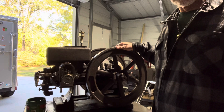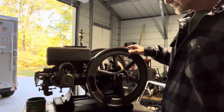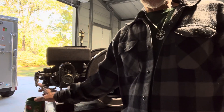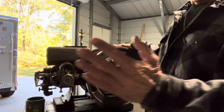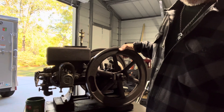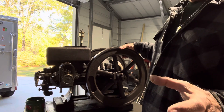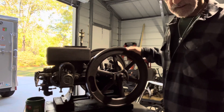We got 226 degrees on this engine, so I'd consider that fairly good — it's within the 225 to 230 range. It's a good way of seeing whether you've got the cam gear where you need it. If you can't get 225 to 230 through the adjustment at the end of the rod, then you need to move your cam gear either forward or backwards depending on what you need. If you need a longer duration — say you came up with 225 — you may need to move that gear one or two teeth to get more.